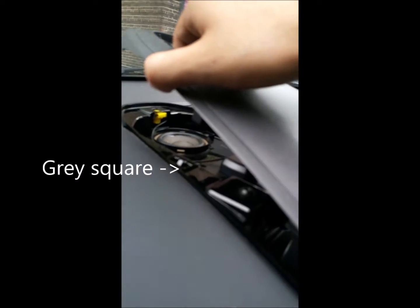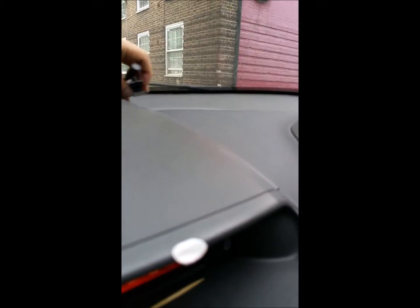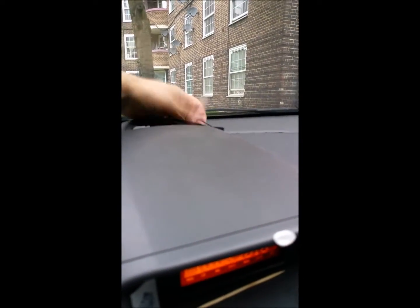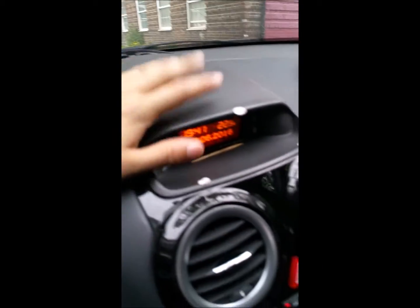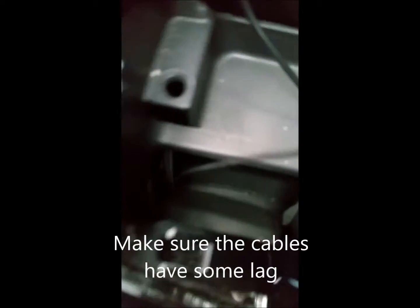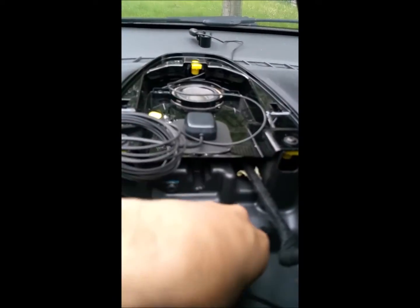All I've done now is basically pull this up, and if you look underneath you can see my sat nav unit there. Further in, in the center, is where I've actually threaded through this microphone piece. That will just basically slot back out — I've threaded some of the cable under there and it will then come back out right here. So here you can see my GPS unit, and here is the remainder of the cabling. All I've got to do is pull that through, and you can see I've slid it down there past these air conditioning units and in through here. Then that will slip back up so I can remove it. That's pretty much how I've done all the cabling, and even for the sat nav, which is very easy to move — I've just threaded the cable back in through this hole and I can unmagnetise it and drop it through.